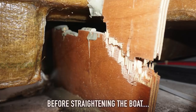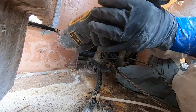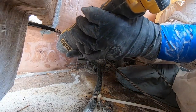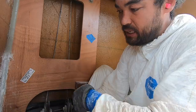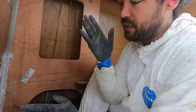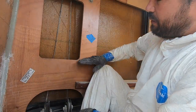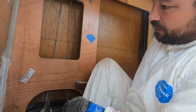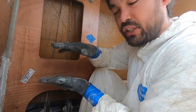This crack in this frame here — the correct way to repair these instead of just glassing over the ply, which is super tempting because you could do that so easily, is to grind out the crack, V it out, and then fill that with epoxy. Then glass over it so the plywood — when there's a crack it's able to freely move — if we fill it all with epoxy and then glass it, it's all going to be completely bonded together. That's why we're going to spread the load and glass all the way up here and all the way down across to the other side of the boat, so this whole thing is strong and stops the bridge deck from wanting to collapse again.